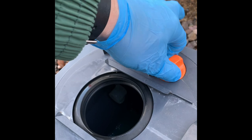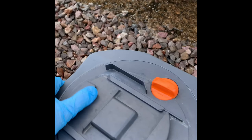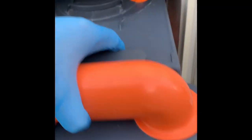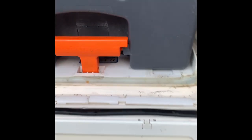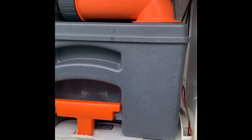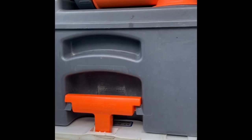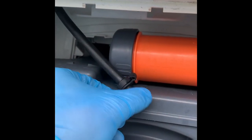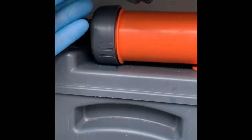When putting it back in, close that flap, put that across, then simply lift, slide it into place and it clicks down. When winterizing, because you've got pink fluid in there, sometimes this will require emptying. There's a little pipe just above the cassette that comes down — take the little bung out and that will, just using gravity, empty out all of the fluid.